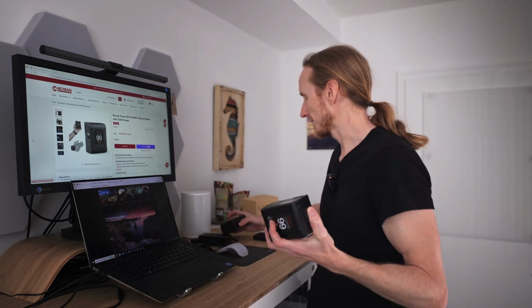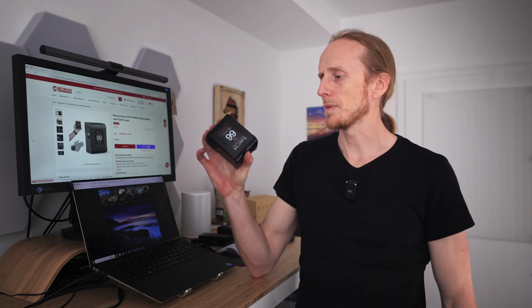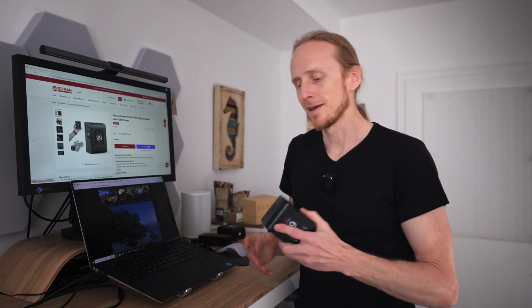The thing I also wanted to mention is size-wise, it's nearly the same still. I think this is roughly 600 grams. So it's not lightweight, but it's very compact. You can usually fit it into your bag somewhere. It's also with 99 watt hours still not too much to bring it onto an airplane. I think 100 watt hours is the maximum a single lithium ion battery can have in terms of capacity. Otherwise you're not allowed to carry it on an airplane. That's why most of those batteries just cut off beneath the limit. So that's nice. And it's a very versatile battery.